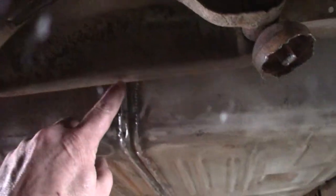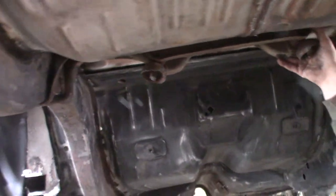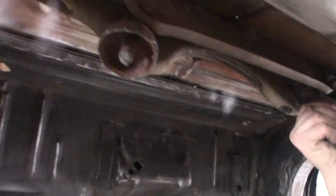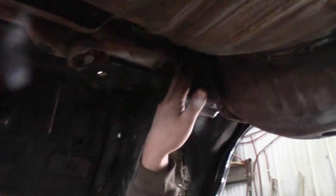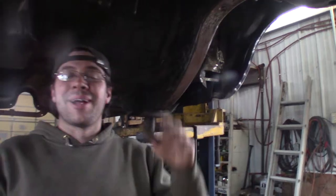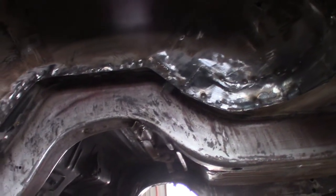And this trunk pan here goes all the way - this is a two-piece, like an old retrofit replacement panel. Now they make one piece obviously, but they're hard to get in the car. And then this is your shock crossmember, which I bought - this is a used piece out of a four-door Satellite, I think. You would think that they get spot welded to the trunk pan and then spot welded here, but factory it's one spot weld there, one spot weld there. My guys put air shocks and then up top too - carried the whole car on just this top lip. There's no support there at all. You throw air shocks on, you jack the car up and you're putting a lot of weight on a little piece of tin. It's really not good.